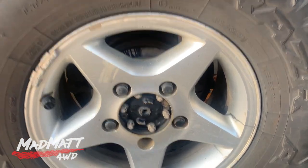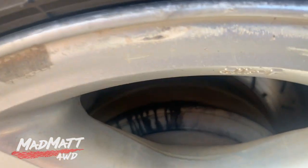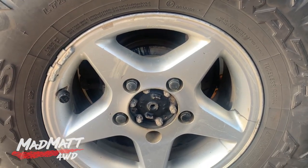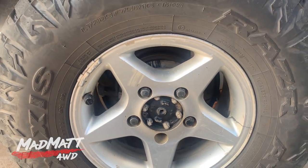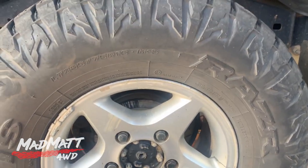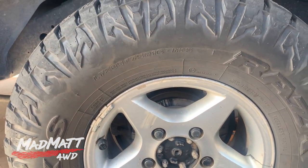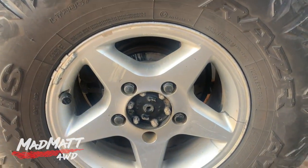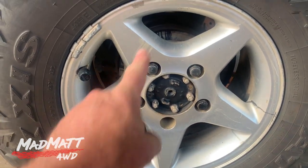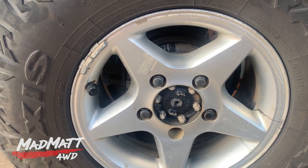But I forgot to do that. That wheel stud broke, and you can see the fretting marks here where the wheel has been wobbling on the hub. I was driving along on the way home and in the last 100 k's of the journey I heard a bang — which was probably that wheel stud coming out — and then I felt a bit of a vibration start to develop. When I got home and was walking around the vehicle, I spotted a mark and a loose bolt, and that's when I realised I forgot to torque the wheels up properly.